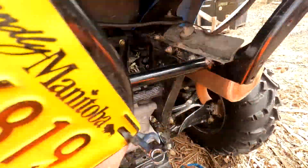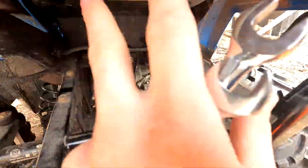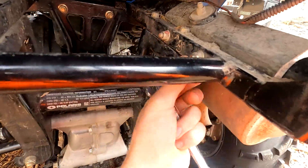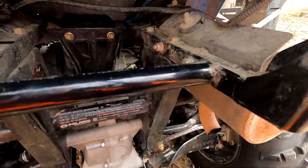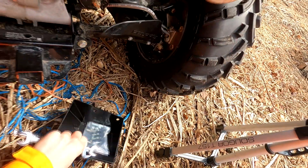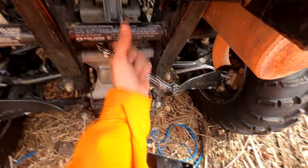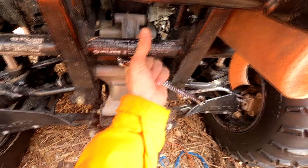Normally if you're doing the battery relocation kit, you just put some bolts through here and do her up. Because I'm doing mine inside here — because there's normally a box here that's not — you take two half-inch bolts, do one on the inside. You have to undo the muffler bracket, so I'm just undoing that, and then I'm going to put those through here — these two holes through the bracket. Bolt it on.